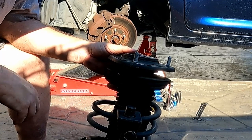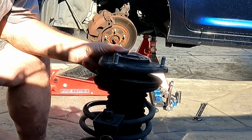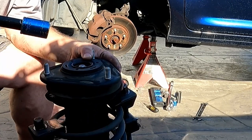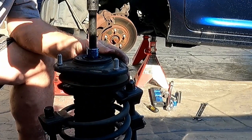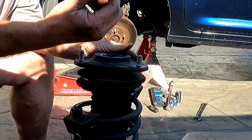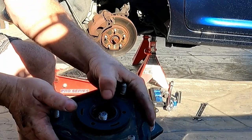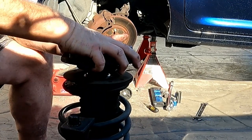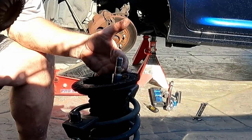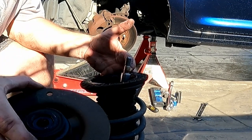These are the old ones so we can lock on with some vice grips if the shaft spins — no big deal since these are throwaway anyway. It's a 19 millimeter on the top, and the nut came off perfectly. The new shock comes with a new nut. There's a washer inside too. Lift off the spring retainer — that's the bump stop, kind of holds everything in place. It's got a bushing on top that's pretty worn out — I might should have got a new bushing.